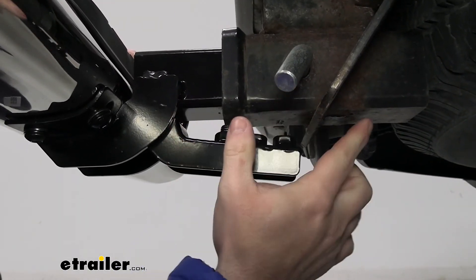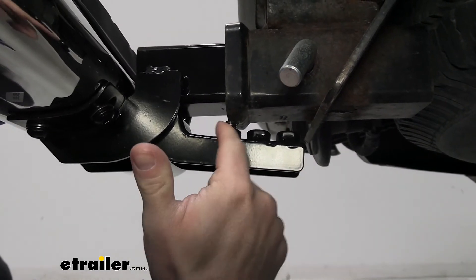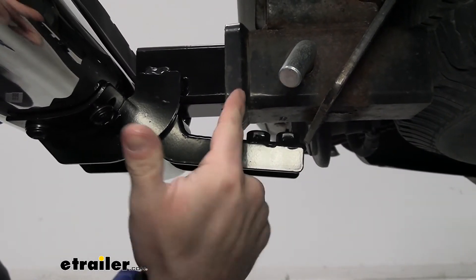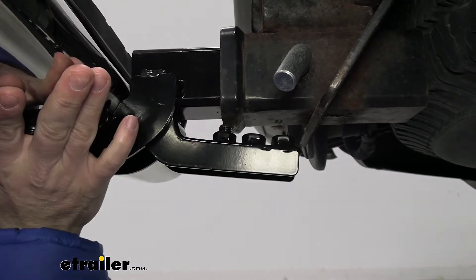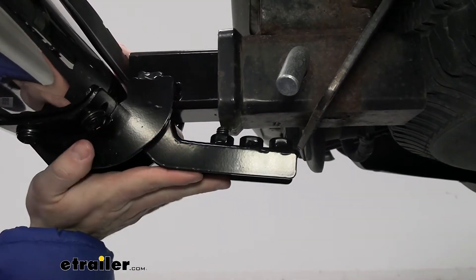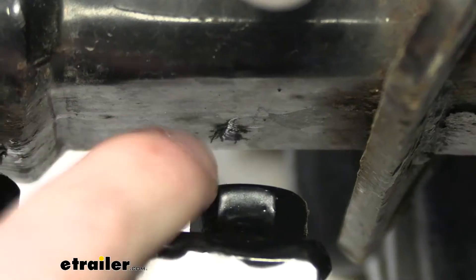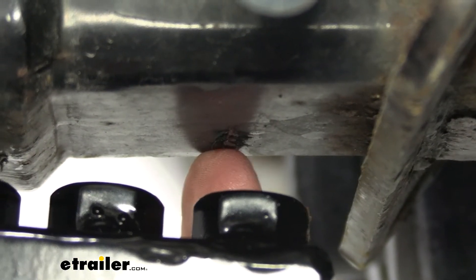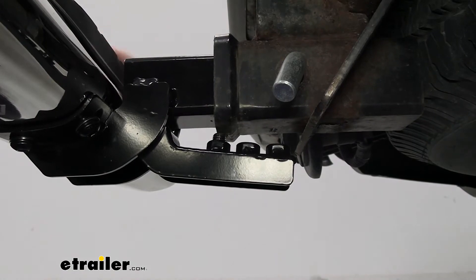You have three points where you can run this bolt in and it helps stabilize the step, and you have three holes in the shank here to help line that up too. I used this one here to line up with the lip of the hitch, thinking that maybe there'd be more bolt pushing up against the hitch helping stabilize it, but it didn't really make much of a difference. It still goes back and forth. Don't over-tighten it either, because as you start to tighten that bolt, it just kind of walks across the hitch and scars it up. Make sure it just gets nice tension with a little pressure on there, and then don't torque it down anymore.